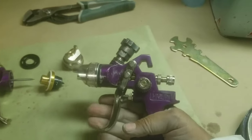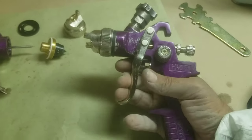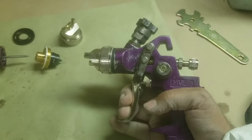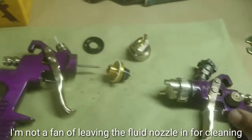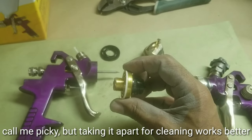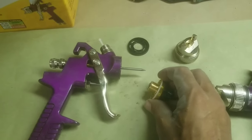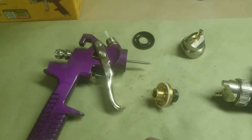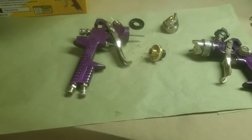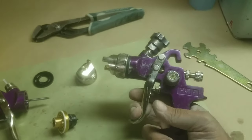The reason people say it is a throwaway gun is that if you shoot it the first time and it shoots great, you're not going to be able to shoot it again at the same quality unless you clean it out. Since the flow cone wasn't made to be removed, that's why they call it a throwaway gun. But if you remove it, keep the gaskets and seals cleaned, and replace some of the O-rings, it's going to work fine. It's not going to be a throwaway gun — and that's not bad for $9.99.